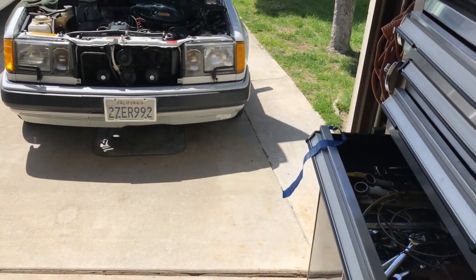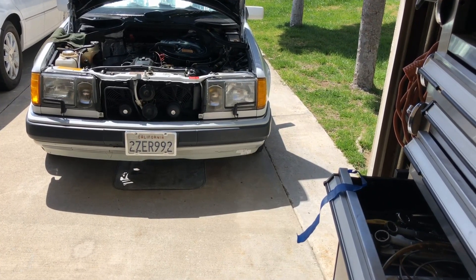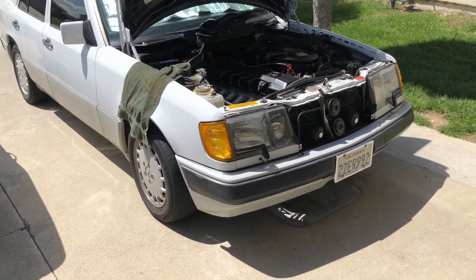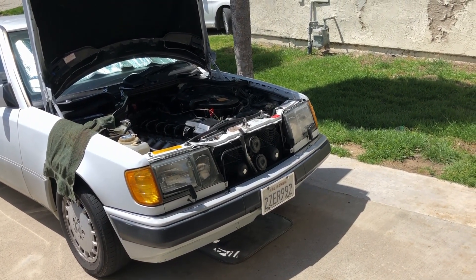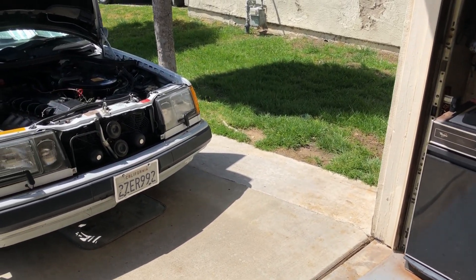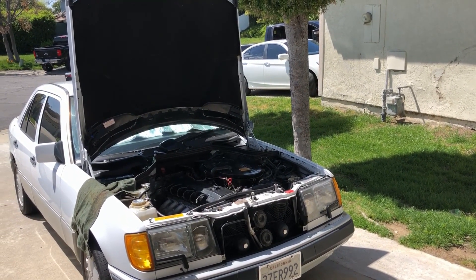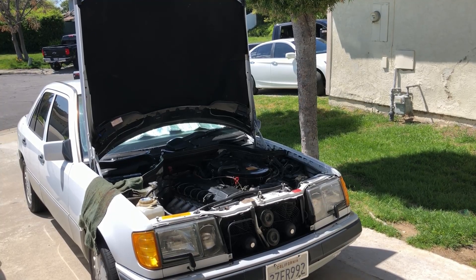Some people say if the car runs good and it passed emissions, don't mess with that valve. I think I'm going to put it back on - I can see it's holding a little bit. I've never really worked on EGR systems. The EGR valve is the main component - normally closed, it connects the exhaust manifold to the intake manifold, controlled by vacuum or a built-in step motor. The function is to control exhaust gas flow being recirculated depending on engine load. It returns a small portion of exhaust gas through the intake manifold, lowering combustion temperatures and reducing NOx emissions - basically smog.